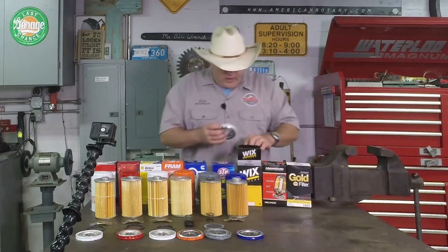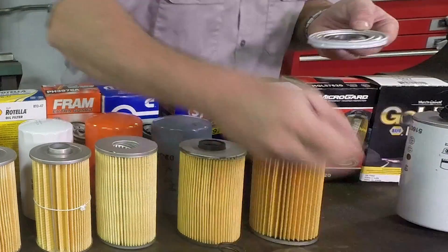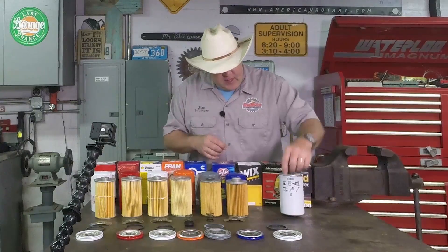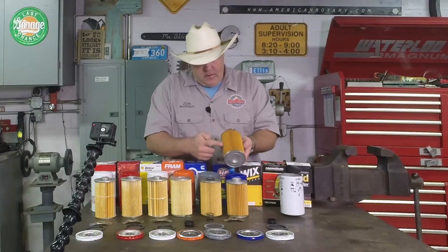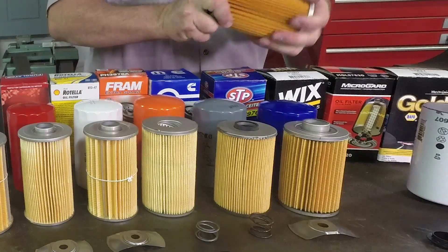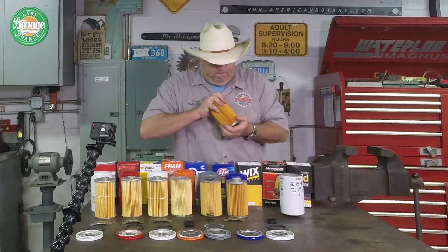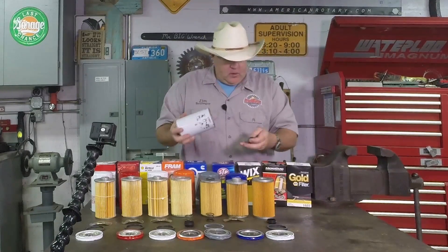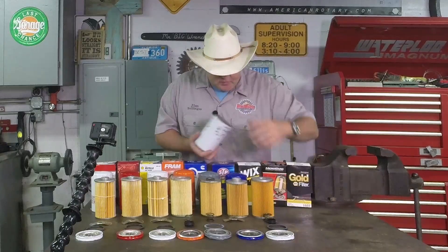Next we'll do the Wix filter. The base is of acceptable quality. The O-ring is nice and thick, just like the OEM filter — heavy duty, thick filter, very heavy base. There is a plastic joiner to act as a gasket between the base and the actual filter. The filter material is very consistent all the way around. There is a metal joiner to join the pleats together — no surprise for a Wix filter. Very, very rigid. It's got some hot snot gluing the filter to the end caps. This filter is no joke — it's a very robust filter. It also has a very heavy proper spring, by far the heaviest of any of the springs in the filters so far.